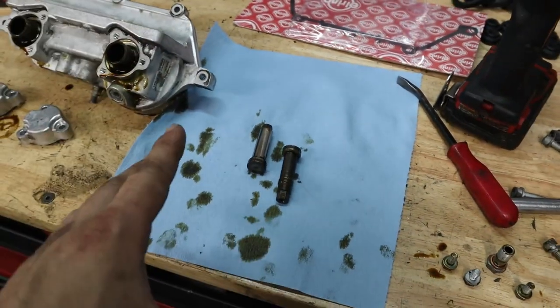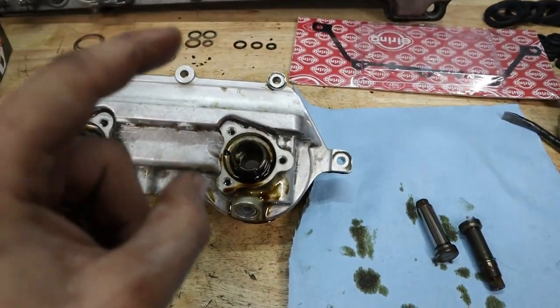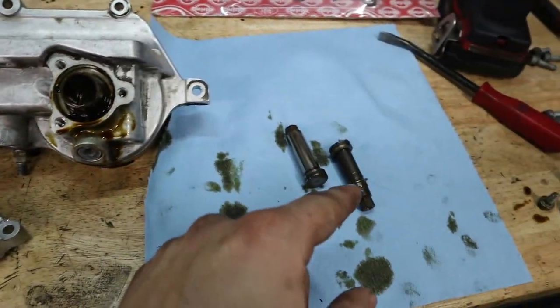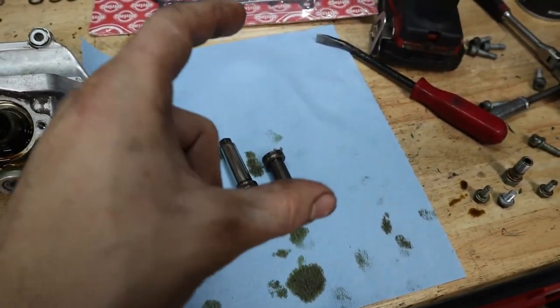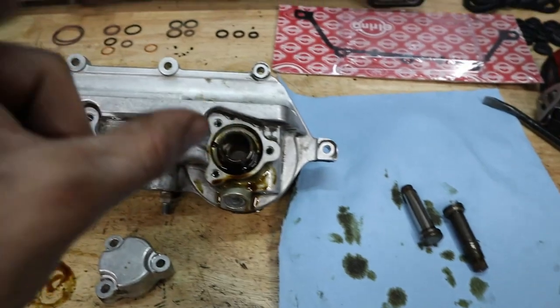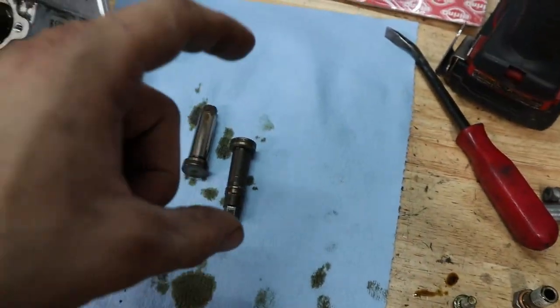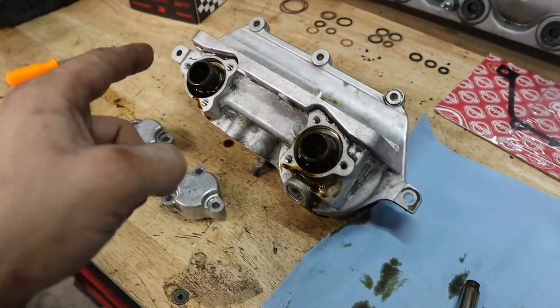And then the instructions online tell us to just try to fit them in here to get them closed off, because a lot of times since you're stretching that Teflon seal to get it on the plunger, it's not going to fit in here on its own anymore. So you really do have to compress it before the final installation.